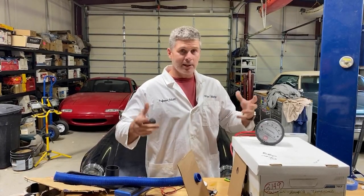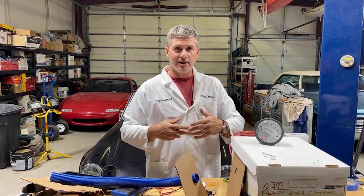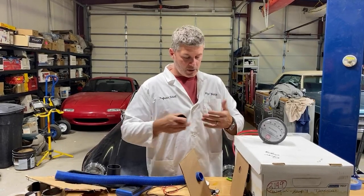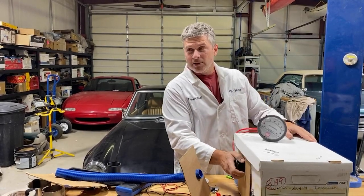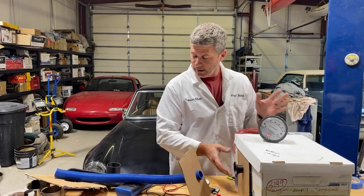You know, we did one that looks like the radiator everyone thinks should win. It's a triple pass, great big thing about that thick, massive, and it just sucked, it was terrible. But it was because it didn't have the fin density. It was too thick, which increased the resistance for the air going through, lots of reasons why it didn't work. But that failed experiment could have come across as a failed experiment, or it could have come across as proof that the product didn't work.